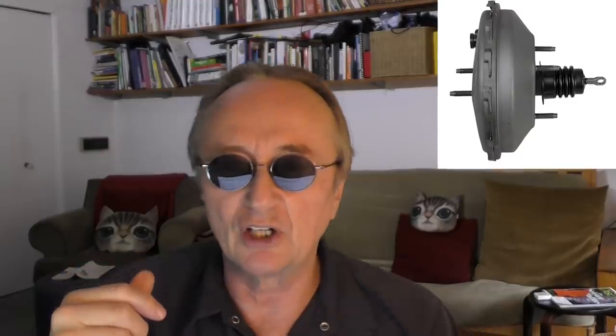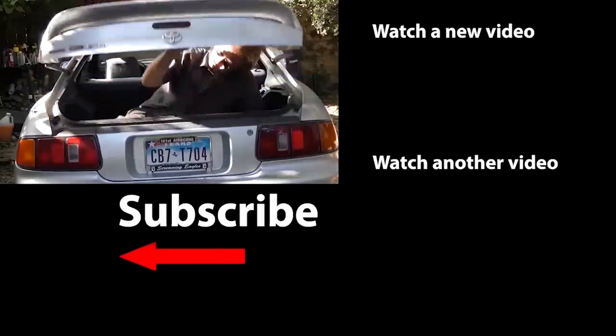The hose could easily be cracked somewhere and then sucking air and you won't have any boost. Now, if all that's okay, then your power booster is shot, and you'd have to get another one. At least it's a Ford Taurus 2001. You can get remanufactured boosters. You don't have to buy the $500-$600 brand new one. The rebuilt ones work perfectly fine. You can get them all day long for 100 something bucks. You don't have to buy the brand new super expensive one. Those have been out so long that guys rebuild them all the time.